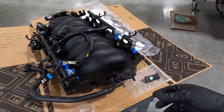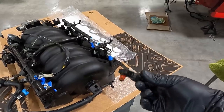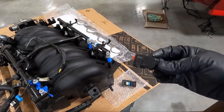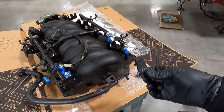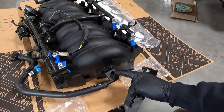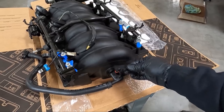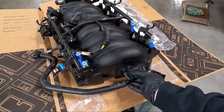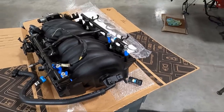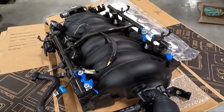There is one other thing I want to show you guys. I got a new MAP sensor. The MAP sensor in the factory cars only measures a certain level of boost — it's just a one bar MAP sensor — and obviously we're going to go over that. I decided to go with a three bar MAP sensor, which I'll list down below. It came highly recommended by people on LS1Tech, and John at Here On Speed told me this is what he normally uses with a stock manifold. Just be careful pulling the old one out — pull this tab back, don't break it off, fold the old one forward and sneak it out. I'm going to push this new one into place — it can really be done with one hand, just like that. It doesn't feel quite as tight, so I may put a zip tie around it just to make sure it sets snug.